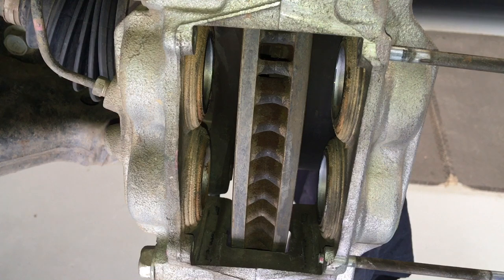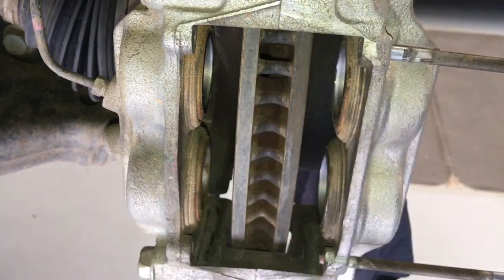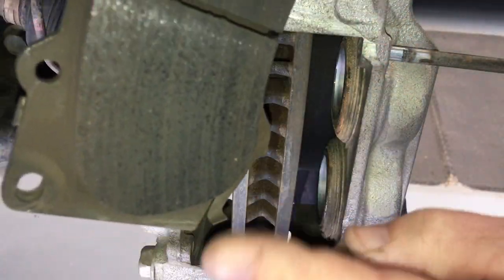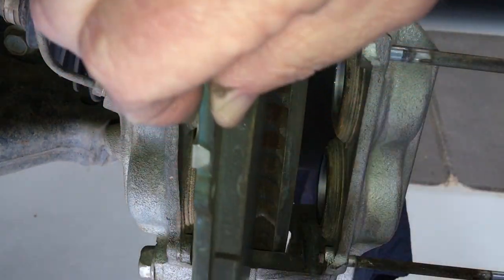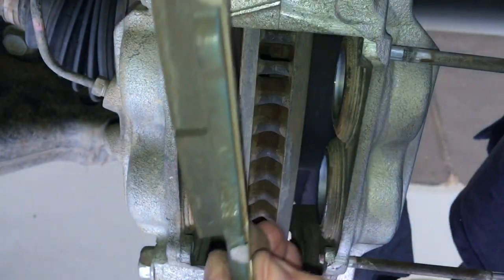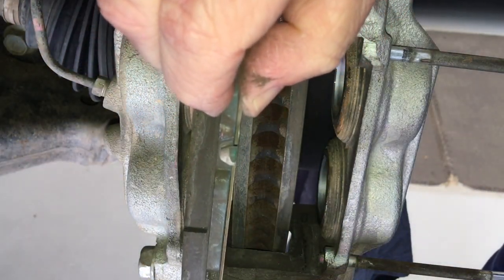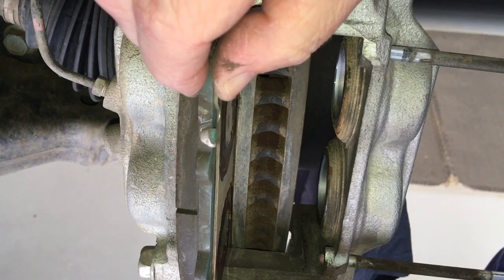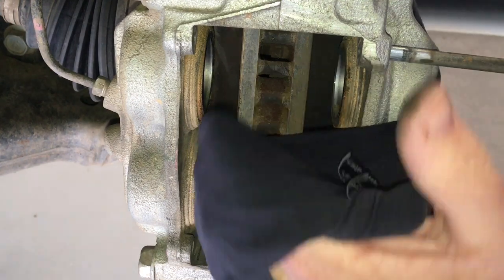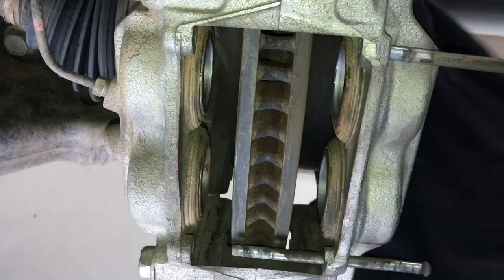I'll go put the grease on. If you want to see how to put the copper grease on, watch our other video — there's one doing the rear brakes. So we've got our copper grease on a little bit under the plate, a little bit on the outside. The one with the wear indicator goes on the inside usually — I say usually. What's imperative is don't put them in back to front. This is the things we've seen in other workshops — brake pads put in wrong. I'm not going to demonstrate it because the grease is going to get on the surface of the rotor. Brake surfaces we want to keep clean — no grease.